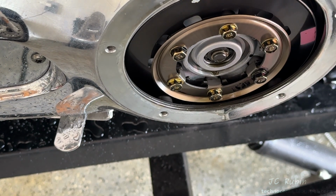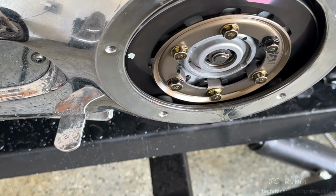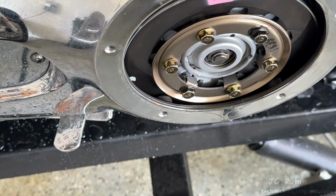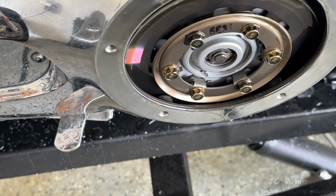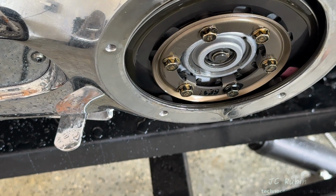I have a dry clutch, I usually don't deal with this, but I'm gently rocking the wheel in first gear to loosen it up, and we could see that after about 10 seconds, it's getting easier and easier to rotate it in gear with the clutch depressed. I do have a cable tie holding in the clutch handle at this time. The rest will loosen up when the engine's running.